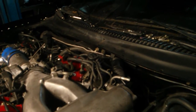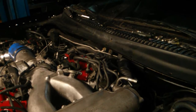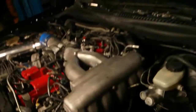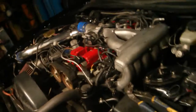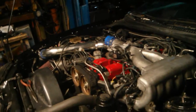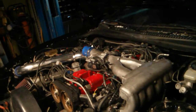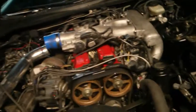Don't block off your EGR — and not just because it's illegal. If you're trying to do it for performance on a stock computer, don't do it. Under certain conditions the engine tells the EGR system to turn on or off, and when it does that it changes the air-fuel ratio because it's expecting those changes. Your check engine light will come on, your gas mileage will be horrendous, and your air-fuel ratio will be off. Unless you're running an aftermarket computer, leave your EGR valve connected.